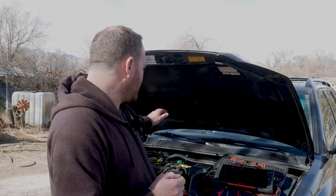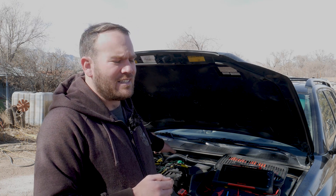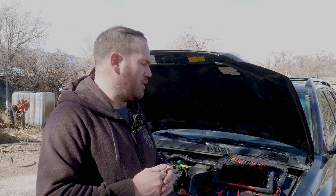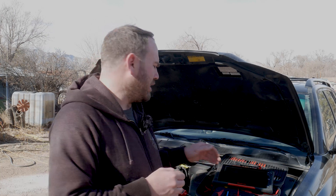This is a Toyota sensor mounted on top of the air intake box — easy to get to. Most manufacturers are easy to get to. We're going to cover the GM frequency style mass airflow sensors in another episode, so this is just going to be the voltage style. A lot of the modern vehicles also have an intake air temp sensor built into the mass airflow sensor, so the computer can have everything in one location. Some of the newer vehicles are also including a pressure sensor into that as well. But this test will cover probably 70% or more of the mass airflow sensors out there.